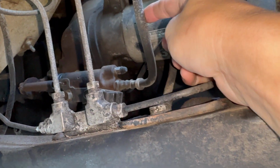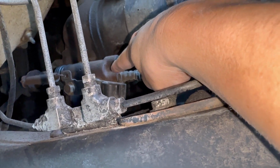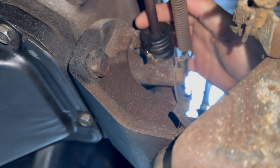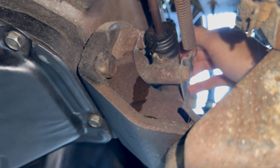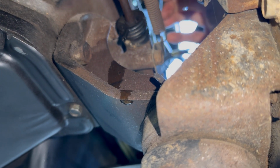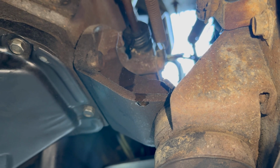Here we have the clutch slave line, which is also date coded with 11 of 78. And there we've got the clutch slave. So what concerned me the most on the clutch slave was actually this fluid coming out of the drainage. That is literally brake fluid. So the clutch slave has failed. And that's why I bought that. Another hydraulic component that I don't want failing on the maiden voyage. It's cheap enough to replace and not worry about it in the future.